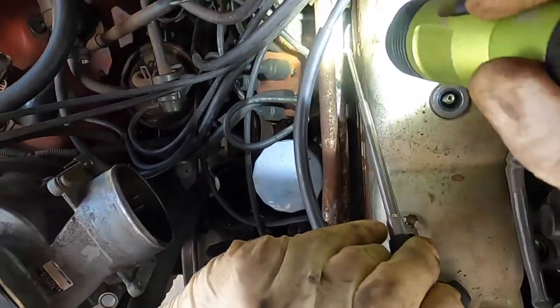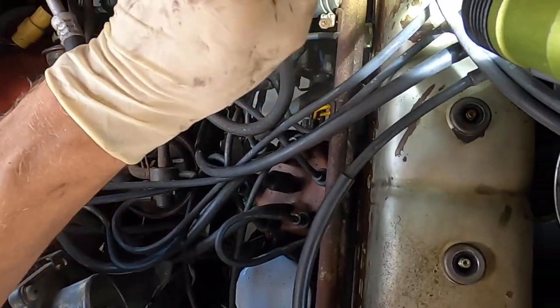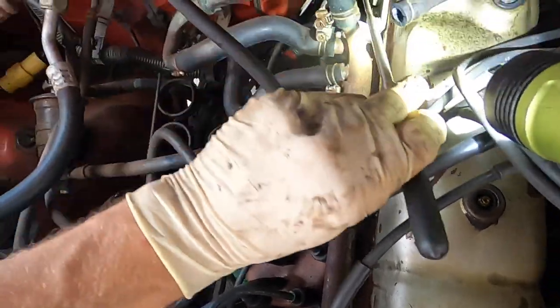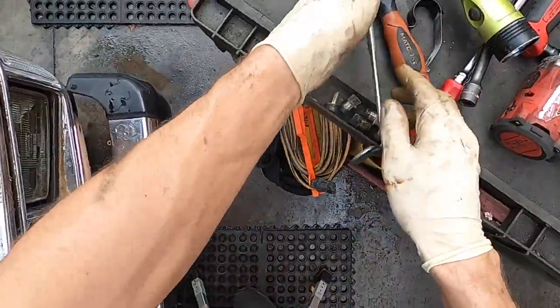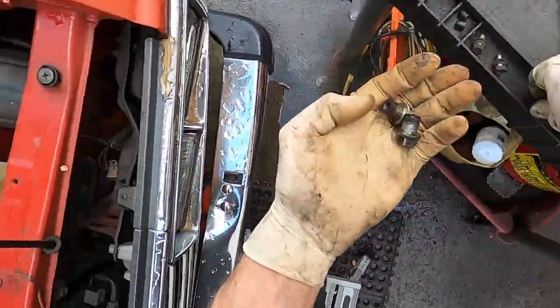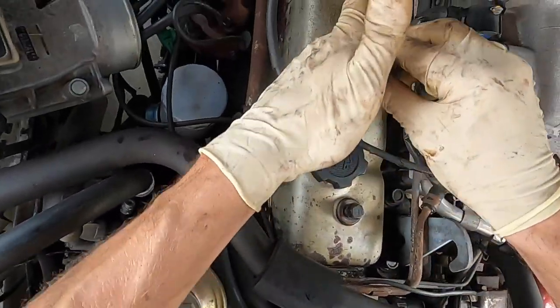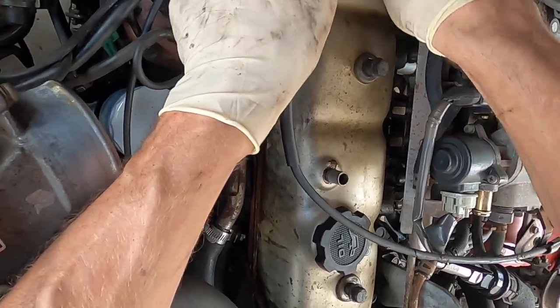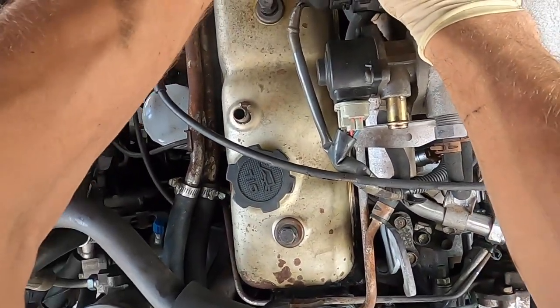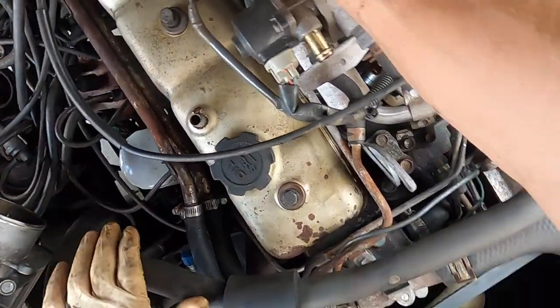This is time consuming — it will take some time because your mirror won't fit in all the little spots. But give yourself some confidence in your repair and stick a mirror down in there and verify. Now center your holes up and hand-tighten first. Just get them all started by hand. You don't want to cross-thread anything either — that's a big no-no. It happens, but it's avoidable. Start that by hand.